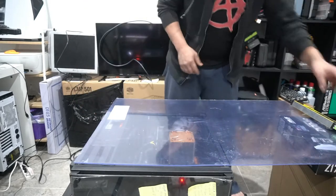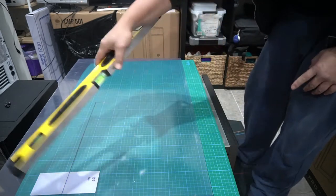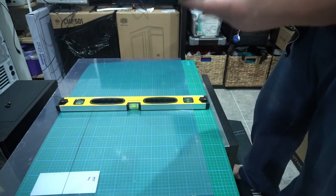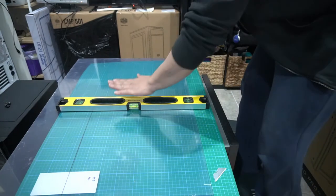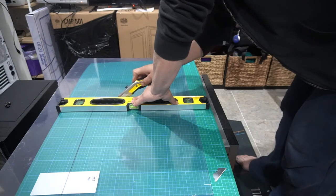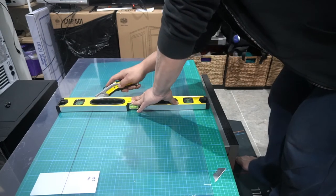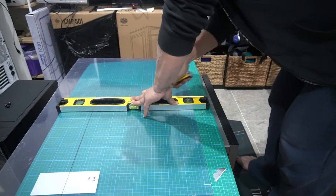Now all we have to do is cut it. This is like a piece of rubber that's going to allow me to cut, and it also has lines on it to guide me for straight cuts. I'm simply going to line this up with the line. This is what I mean by a utility knife — here in Australia we call it a Stanley knife. A very sharp blade that's going to allow me to keep scoring it until it cuts through. I'm going to make sure I use a completely new blade so it's very sharp. We need to apply a lot of pressure so it does not move at all, and then we simply cut straight — nice and slow running along the edge. Just keep repeating it until you're almost through. With every cut it's going to get deeper and deeper.